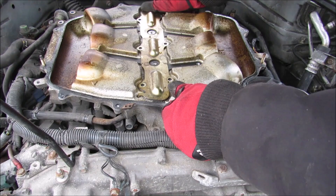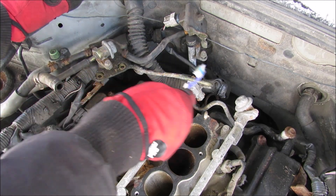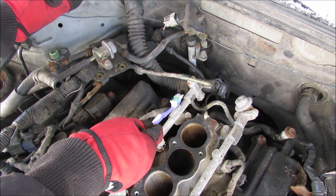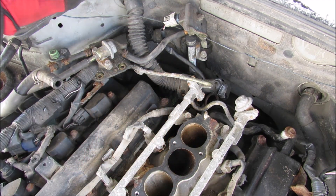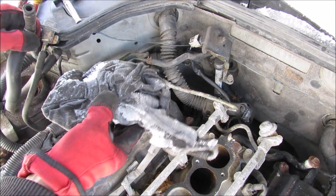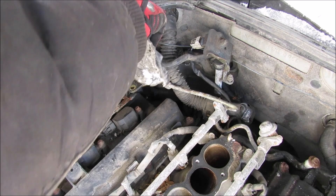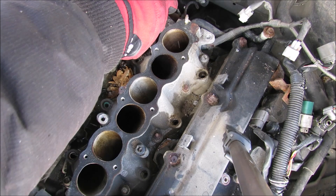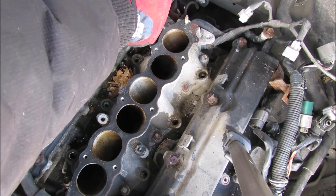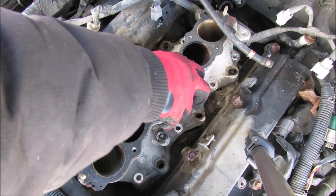Now I'm going to remove the air intake collector. Here we have the connection for the fuel line that comes in from the fuel tank and is distributed to the two fuel rails. In order to get this intake off I need to remove this fuel rail and fuel connection. Fuel is spilling everywhere — I'm just going to use a rag to soak up that fuel spill. Just going to lift the fuel rail off and remove a couple of 12mm bolts, then reach in and remove the intake manifold off of the stud.